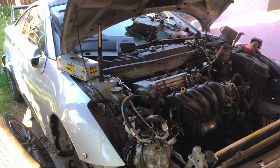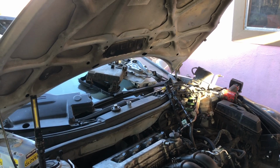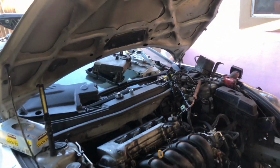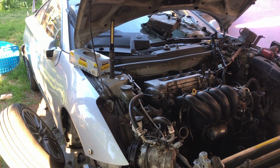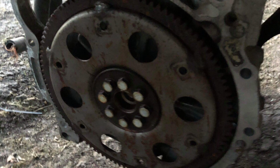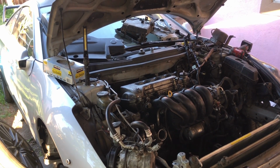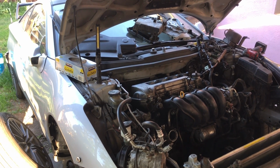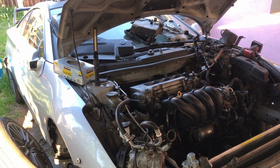I already made the intro to this video, but I guess I could just go at it a little bit more. He ended up getting, I'm gonna actually call them out because they sell trash engines, they're known for it all over the place. JDM Tokyo in northwest Sacramento sold him a 1ZZ from an MR2 Spider, and funny enough, they sold it with an automatic flex plate. Even though the automatic or SMT MR2 Spider uses a flywheel from a manual with a clutch, the clutch assembly was enabled and disabled with a hydraulic pump. So in short, they slapped on a flex plate and told the guy it was from an automatic when really it's from a manual.